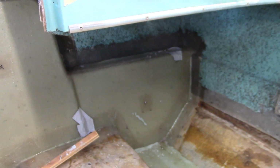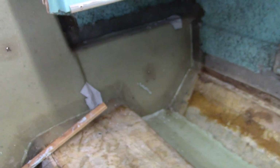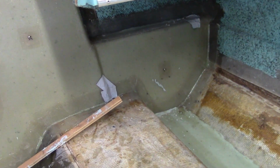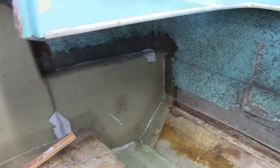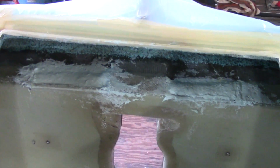And then we've got the transom, which we got 100% full. In the 2 corners, the very corner on each side, I put a 3/16 hole, and we basically tapped on the back of the hole until the seacast started poking out, and then I put a piece of duct tape on it. You can see the duct tape back there. Same thing on the other side, and then we just continued to fill up the cavity space till we got to the top.